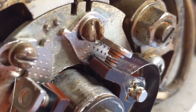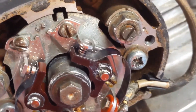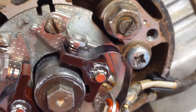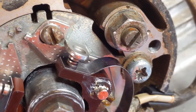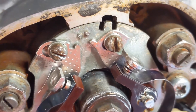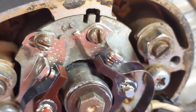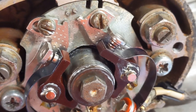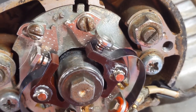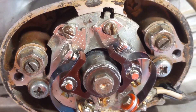The right side was also snug at 12 thousandths, so they've worn in a bit — hopefully they'll quit wearing. I set this one to 16 as well. When you loosen the top and bottom screws on the points, don't loosen them much — just enough to use the flat-tip screwdriver blade in the pegs and tabs. Keep them snug so you can still move them and they'll hold position. Once you have your gap where you want it, tighten both down and check the gap again to make sure it hasn't moved.